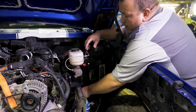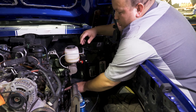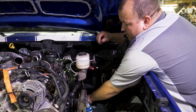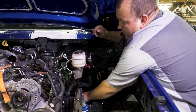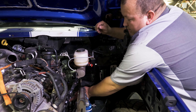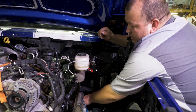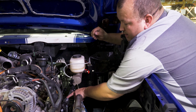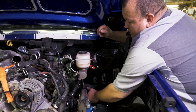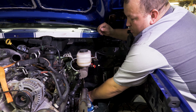For the back support on the other side of the double heim, I used a tube end and a heim joint. Instead of welding the tube end in, I drilled a hole and bolted it — that way if you need to adjust the height, all you do is take the bolt out, loosen the jam nut, and spin the tube end to adjust the height, instead of having to take the heim joint completely off the steering shaft.